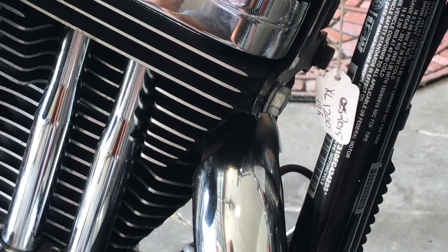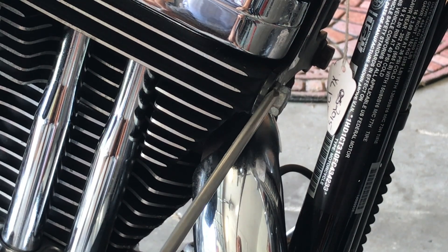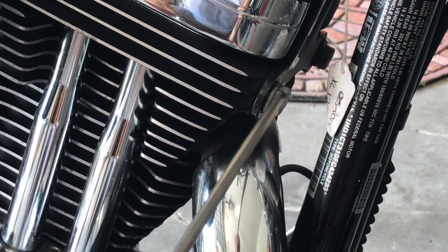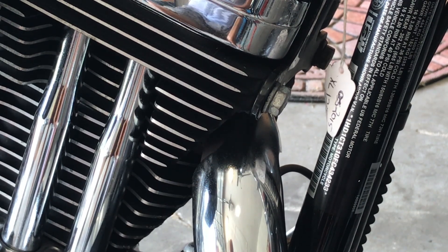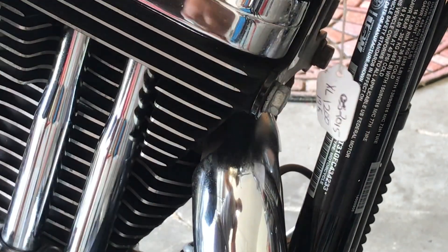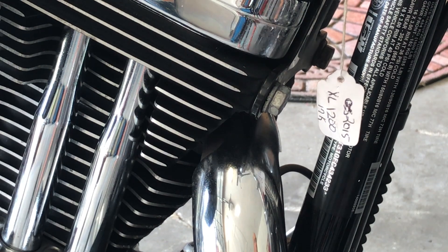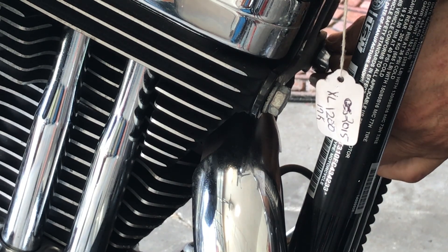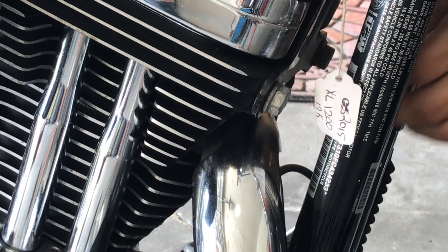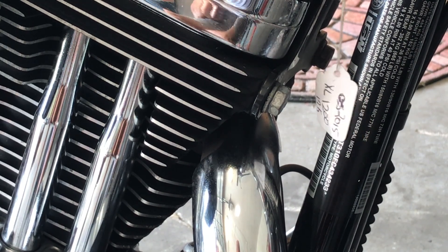Now let's go to the motor mount. For the motor mount — five-eighths right here on the front of the motor. There's two of them. There are times these bikes will come into the shop and they're missing — they get loose. That's tight. I'm going to go around to the other side and check the same. This other side is the one that usually loosens up. Tight. All right, that's the motor mount — that's another popular one.